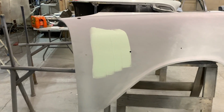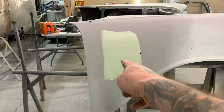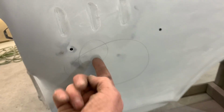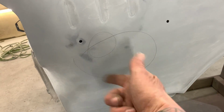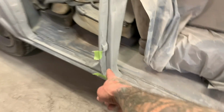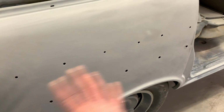The other day when I was talking to Cody, dang, can't think of your last name, bro, I'm sorry. I was talking to him on the phone, and I was block sanding, and he said there's gremlins in the shop because I found another dent right here. And then I found a little imperfection right here when I was blocking. This one's already been blocked out, but I put that big circle to remind myself, and then I put the little circle where the imperfection is. I found that little ding there, and a couple other ones. I circled one here. I still got to weld this piece in. I got to go out to the junkyard and cut that out next couple days. But I circled this one too because there's a little imperfection here. When this car came in and it was in bare metal, this thing was a freaking wreck. I mean, it was a mess. But when we're done, it'll be nice.